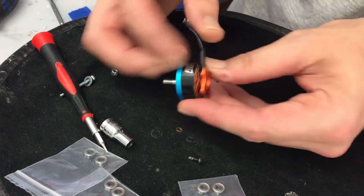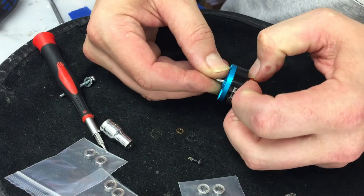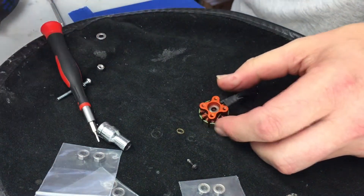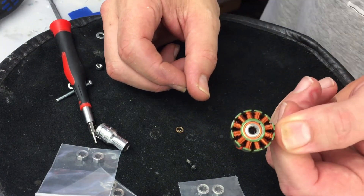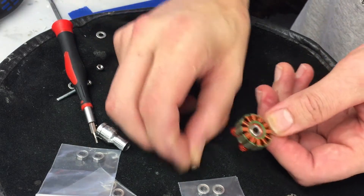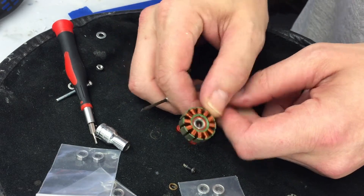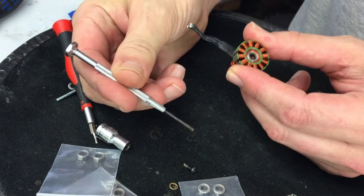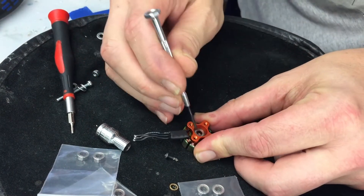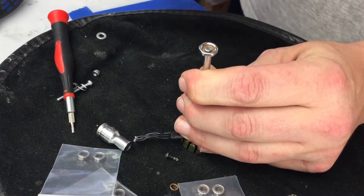This sucker is finally out of there and a bunch of glue came out with it. Got the washer off. Grab this by the base and just pull it off. You've got a bearing in the top and a bearing in the bottom. Normally I use a 1/16 center punch, but on this one I'm using a flathead driver. I'm going to reach inside, grab the edge of the bearing, and get a hammer.